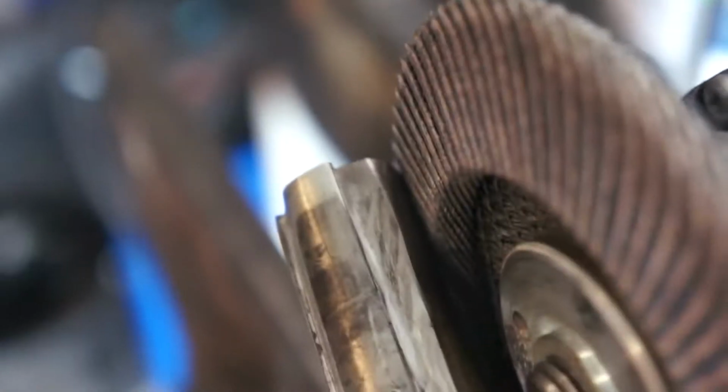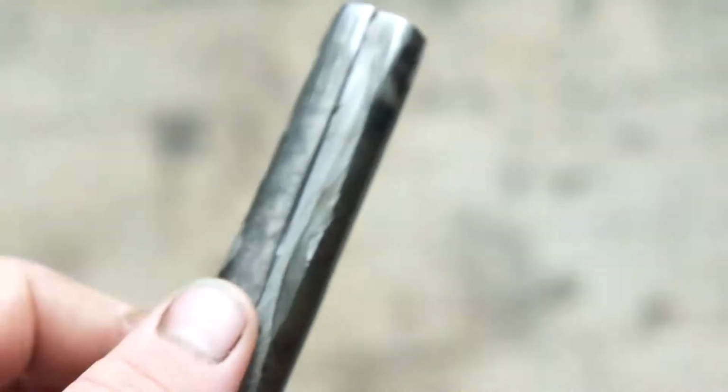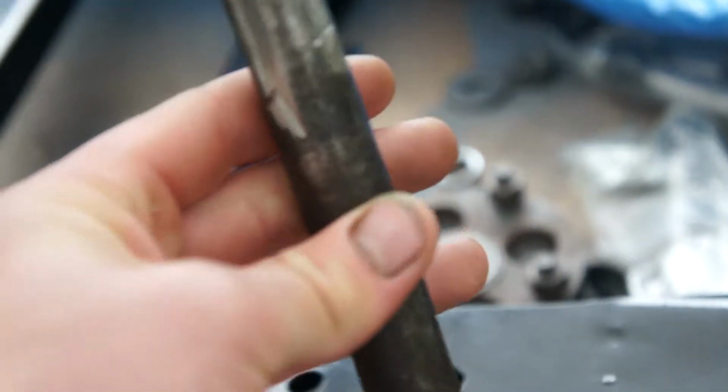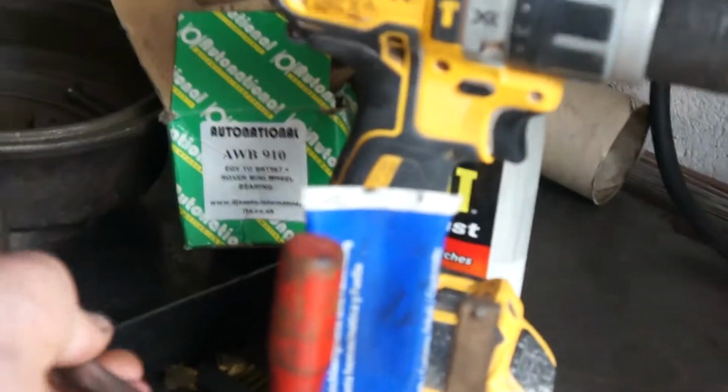Okay, so I've quickly added a small taper, just putting it like that. This now just about sits in the bush, so it will centre itself, or along with this being in the bearings, it will be centred. Put a square thing on the other sided thread so it can be put in the little grip. I'm going to put the arm in the vice and get it going.